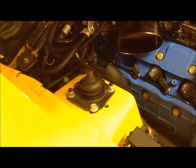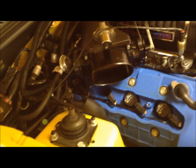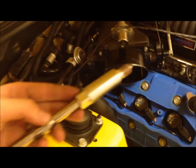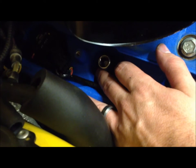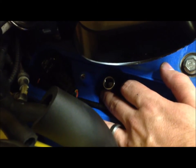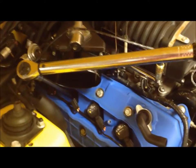This next part's a little tricky because you have the throttle body right above that next hole. You can either take the throttle body off — on my brother's Bullet Mustang, a two-valve motor, the intake manifold goes over there and there's not much you can do. What you can also do is take two smaller extensions plus our socket with the new spark plug. This way I'm getting it down in there — as you can see the extensions are now down here and not in the way of the throttle body, because you do not want to be cross-threading it when you can't get a straight shot.